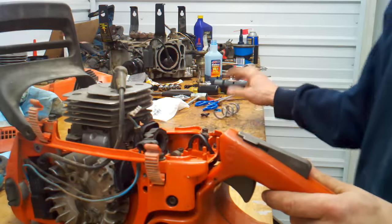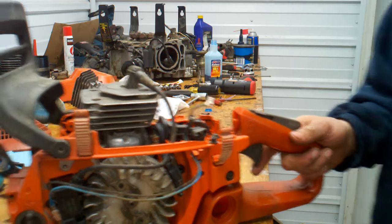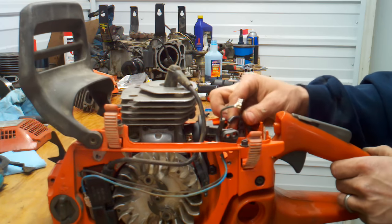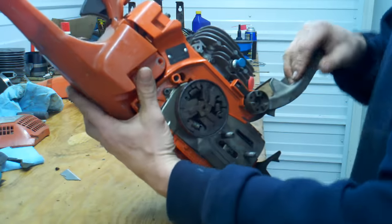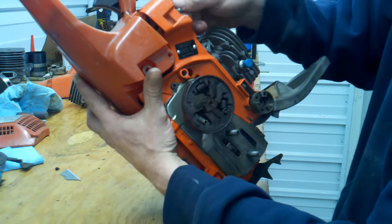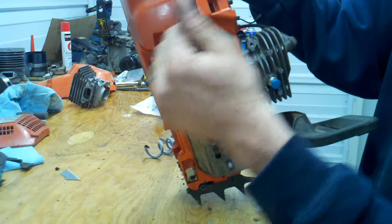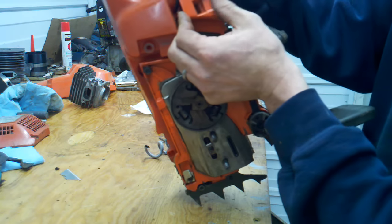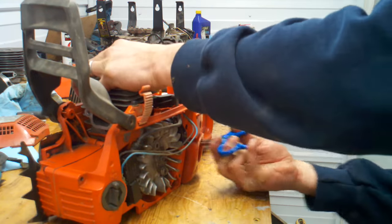What I'm going to do on this one is the fuel line. These lines get hard and they'll crack. On most models they feel fine at the top and look good in the tank, but where they go bad is coming right out of the tank where they flex all the time. All that is is a pressure fitting that just slides into a hole that's a little bit smaller than the hose — that's how it seals.